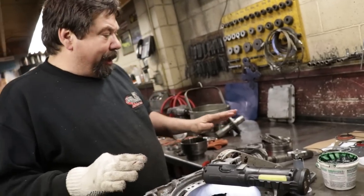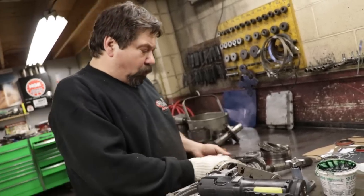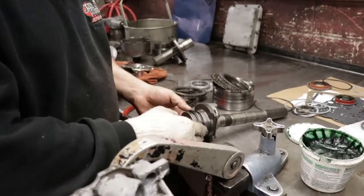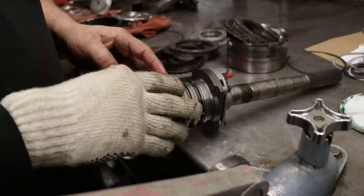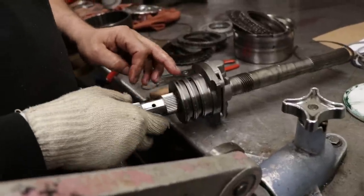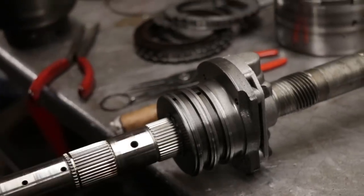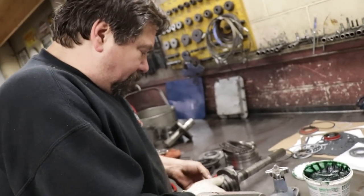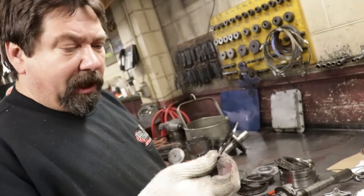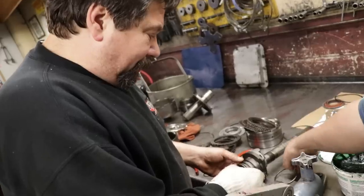When we freshen up a tranny, besides all your seals and gaskets, there's oil rings, right? So these three rings that ride on this governor support seal it so you get your oil passages through there. Some guys try and cheat and reuse the rings. I always, always change them. They're like piston rings, basically. Yeah, they're cast iron. On a C4, they're cast iron rings. So they do wear out like an oil ring. I can use those on my lawnmower.